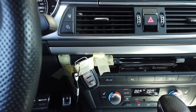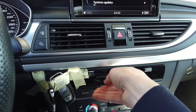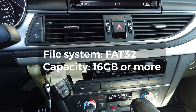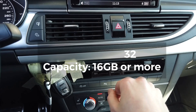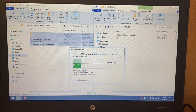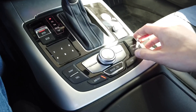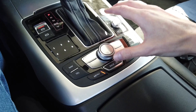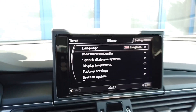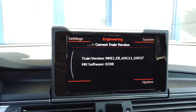The SD card was FAT32 formatted, 16 gigs of capacity. I downloaded the package linked in the description, unzipped it, and copied the content to the SD card. Right now I'm going to enter the red menu by pressing the Back and top-left buttons at the same time. After a few seconds we should be in the red engineering menu.